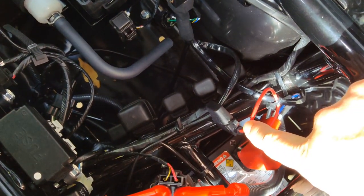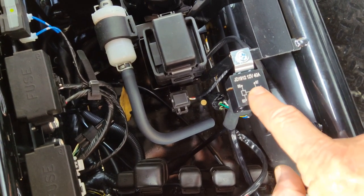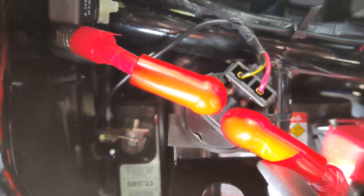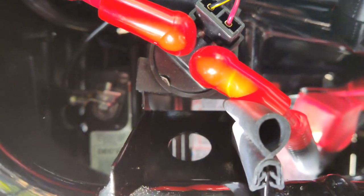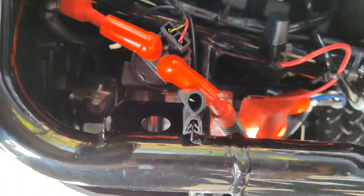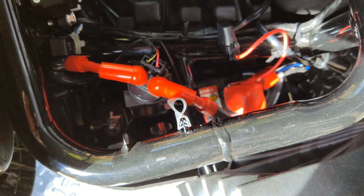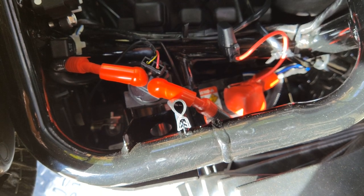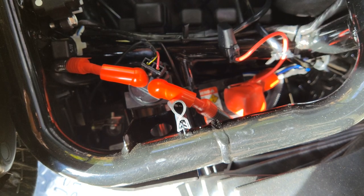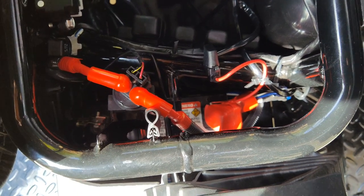And then up through here into the battery section. This is the fuse that comes with the kit, and then this is the relay that I just attached here — just drilled a hole, attached it, and it's nice and tight. The seat shuts no problem. The nuts on the end of the battery are like reversed T-nuts, with a flange section that goes into the terminal and a bolt on the other side that screws in. The only way I could get them out was to use a flathead screwdriver and tap them slowly until they were loose enough to take off by fingers. I connected the positive and negative battery terminals and tested it — everything works fine.